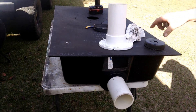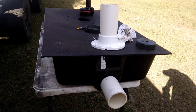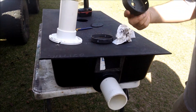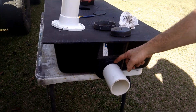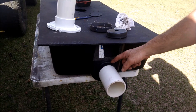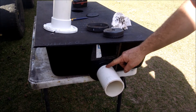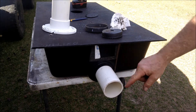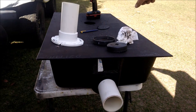This is my black water tank — it's never been used before so I'm having to create new holes. They come without any holes in them, so go to Harbor Freight and pick up a simple hole saw set. That's the size that the pipe will fit in. This piece here — I can give you the link to Amazon — is a rubber grommet; I'll include it in the description below. They come in a couple different sizes. I got the three-inch for three-inch plumbing, and also an inch and a half for my drain vent. I'm using the three-inch on the front of the tank where the cut-off valve will be, and also on the side where the commode will be mounted.